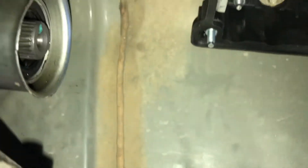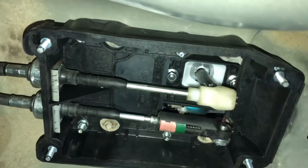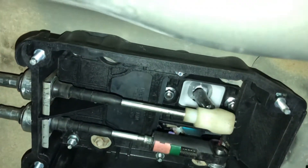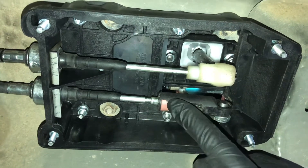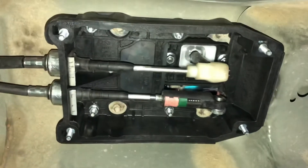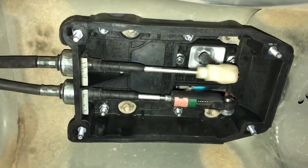The output shaft pops out at the same place. And now instead of the linkage system that you had before, you've got cables. You may need to make sure and get the adjustment on this cable dialed in just right before you close this box up. Otherwise, once the driveshaft and exhaust and skid plates and all the rest of it are in, it's going to be next to impossible to get to it without taking all that back out again.